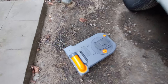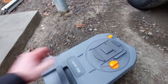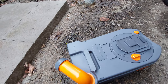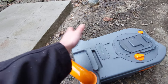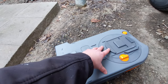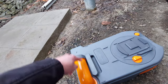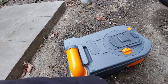To empty the cassette, it's dead easy. Once you've pulled it out, simply pull out the funnel and remove the grey cap on the top. Then at the back, press the orange button in — this releases an internal vacuum and allows you to empty the entire contents. If you're rinsing it, just put a bit of water in to swill it about and empty that. When using blue fluid, remove the cap, use the measurement on the cap, pop the cap back in, slide the funnel back, and pop the cassette back in.